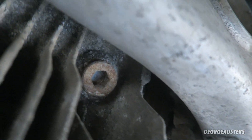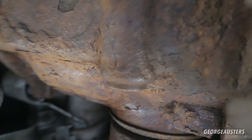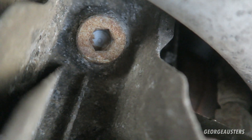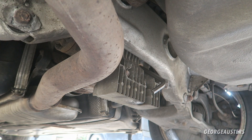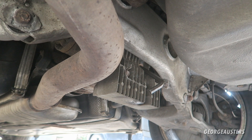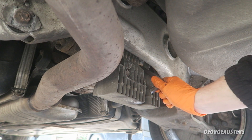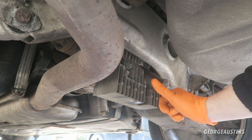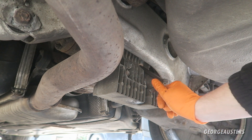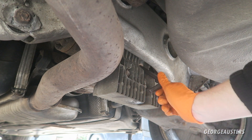The next thing we need to do is remove the fill plug before we remove the drain plug, because the last thing you want is the differential empty and then you can't even refill it. I need to find out what size allen key that requires — it's a 12 millimeter apparently, which is strange because the new genuine BMW ones are 14 millimeter. Let's just hope they are the same threads. I'm having to use the allen key this way around because it's quite far in and I can't get enough leverage.